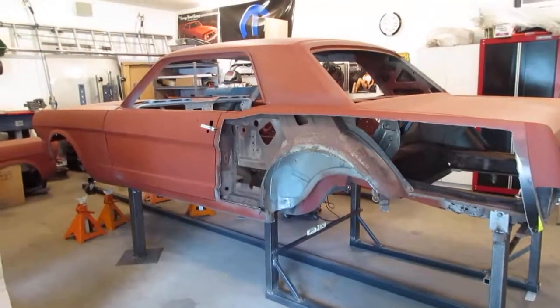Keeping the filler panel and the gutter in place, then letting the new stuff mate up to it. I could have really taken the plasma cutter a little closer, because there's really not a lot on the B pillar plate that is in the way, and there's really nothing up here that gets in the way unless you see this brace right here. I also bought a new tool to drill out the spot welds that are here and across the back, and I'll just use my plasma cutter to go up the seam weld and cut that off, then grind out that lip.